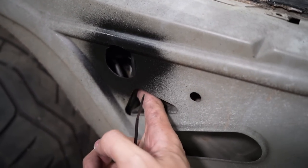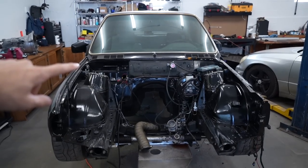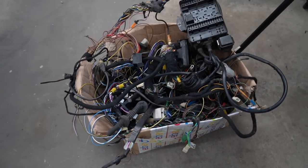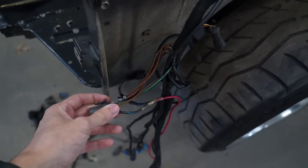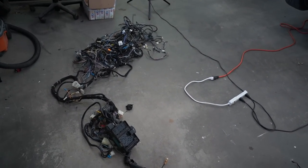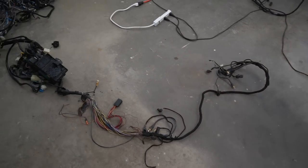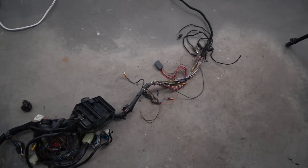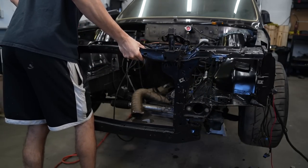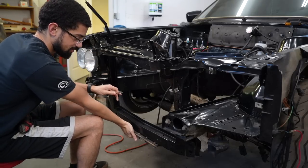Since I deleted ABS I'm also going to keep these ABS wires back here and zip tie them to this hole. Here I have the old chassis harness from my old E30 convertible — I ended up getting a coupe chassis harness off eBay. I knew that these wires would be very useful because I'm going to need to extend at least a few of them. This is the fan wiring right here — I'm going to need to extend the ground and the green wire. This thing just comes in and slides right on — it has the core support now and I'm going to put at least two bolts into it.